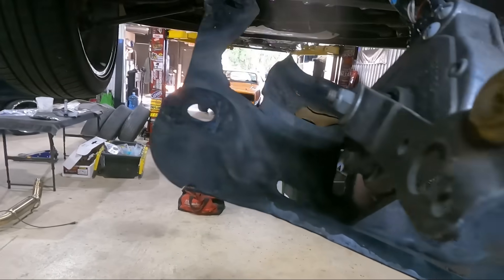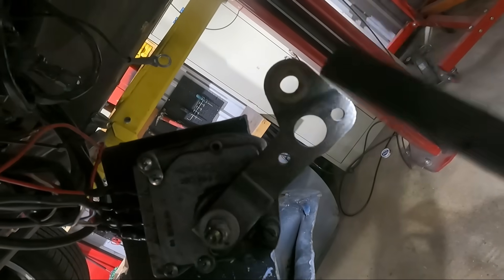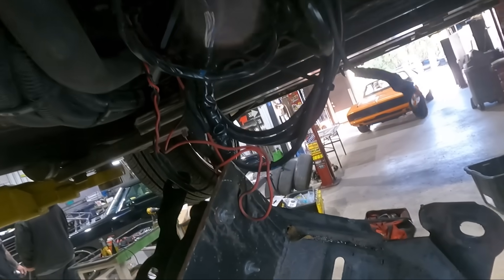In order to get the battery down, I had to take down my shifter control. I have my shifter still selecting drive, neutral, reverse. I'm using the stock neutral safety slash reverse light switch to get 12-volt signals, and our stock linkage connects here. I had to modify it because it's sitting with a custom plate on the transmission shaft — the shaft is pin-welded in a different spot — but it works really well. There's also a relay hanging up right there, and that's what clicks all these signals to give me a drive signal. Now that I've got the front connection off, I know it's safe and I can go finish removing everything in the back and start pulling batteries.